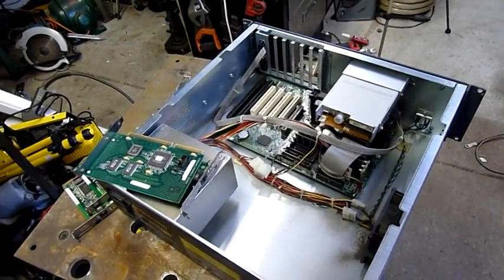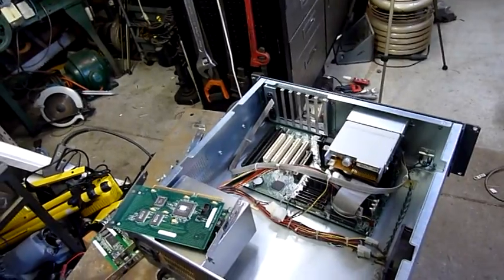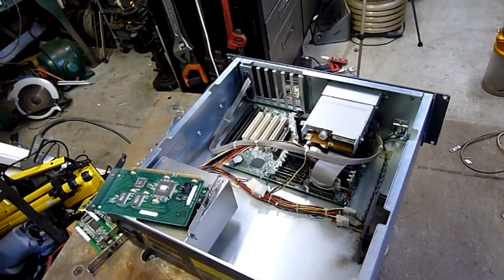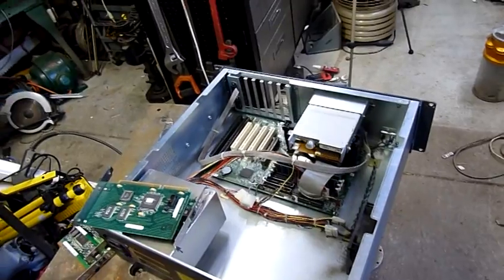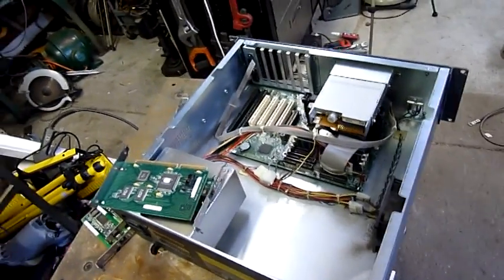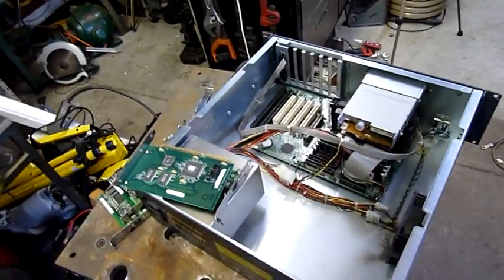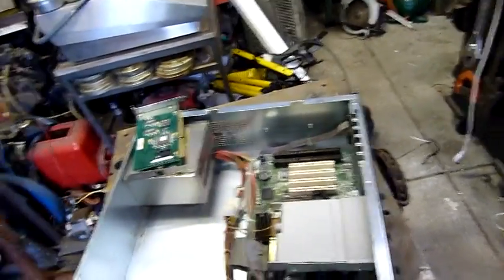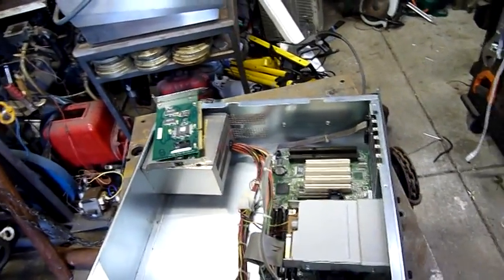In case you're wondering what I would do for a firewall — I've got a couple of good working Pentium 4 IBM ThinkCenter towers. They're full-size BTX towers and since they're BTX I'm very limited in what kind of board I can throw in them, so it's probably good that I kept them. I could use one of those, running newer hardware with a couple of gigabit network cards and the program that people have been recommending. That should do the job just fine and be a lot better than this outdated technology, plus I won't have to worry about setting up a rack mount — and the server I'm getting is also a tower so they can stand side by side in the back room.